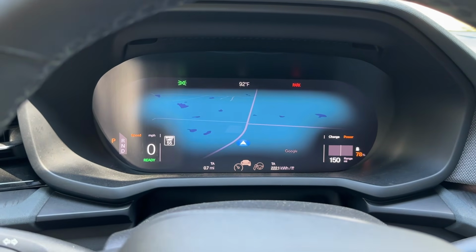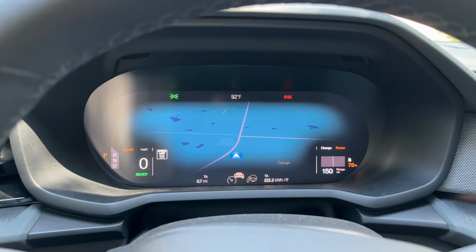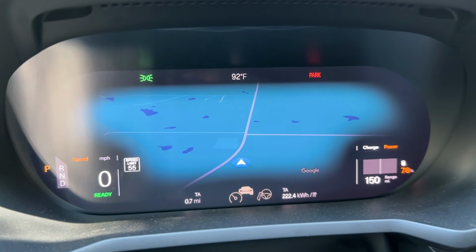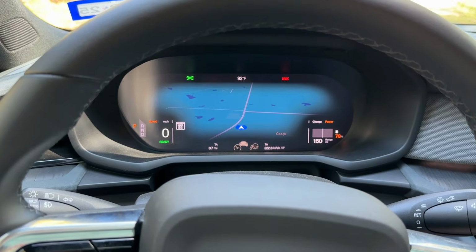At low states of charge, you have basically no acceleration. Below about 6%, 0 to 60 is pretty much impossible in any amount of time under 30 seconds. So taking it on the highway at 5% or less is really sketchy. So that's why I treat 10% as 0.